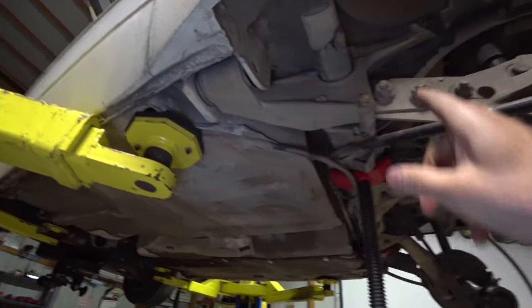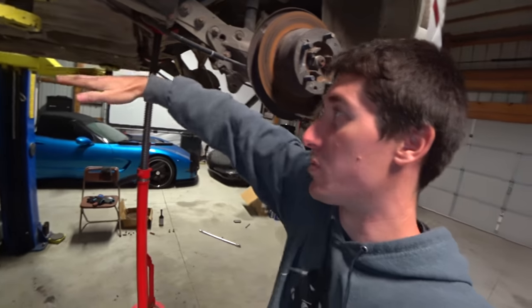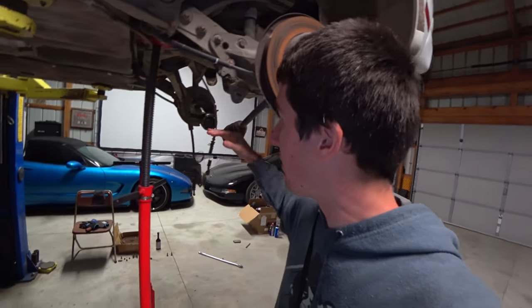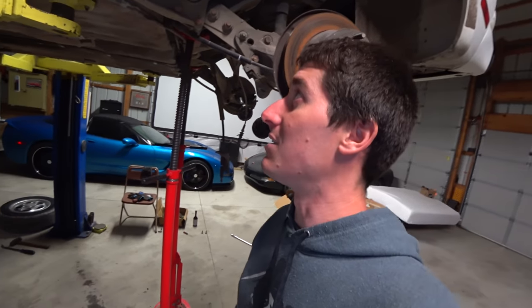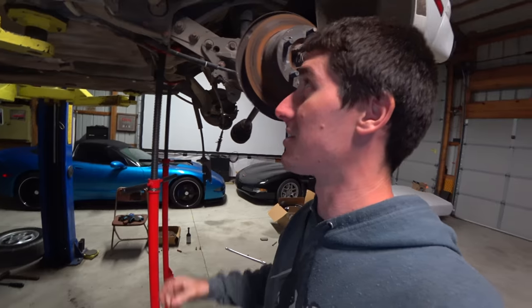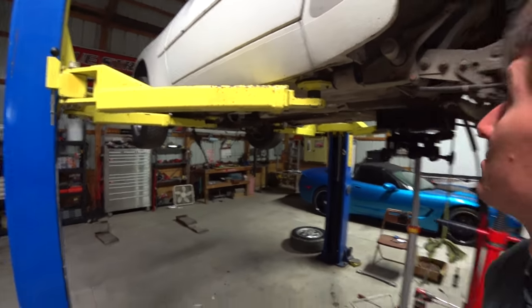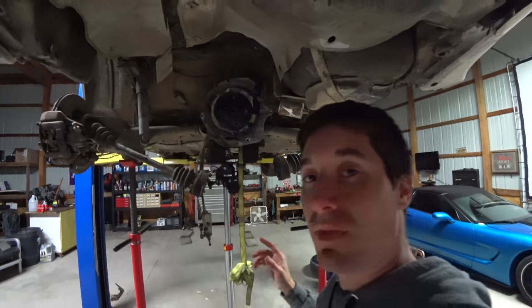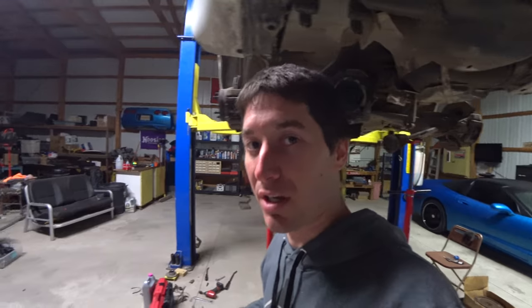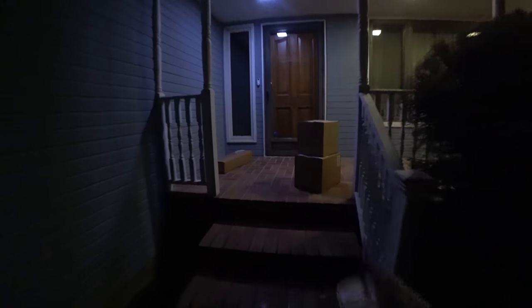Look at this — there's nothing holding the rear in the car and it won't come down no matter what we do. It's probably because of all this weight. We might have to take a 2x4 on the transjack and unload the front of it so we can get it to come down. It is fighting the good fight — that thing is tight in there. I did get the suspension to stop fighting me; it's all the way out now, which gives us a lot of room to try to pull that torque tube down. Still won't budge, so I soaked it with more penetrating lubricant. Hopefully that'll work out tomorrow.